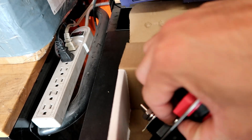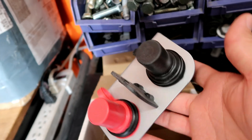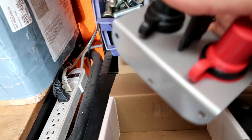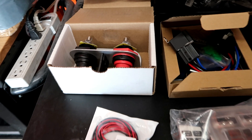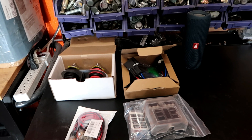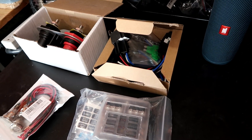Some switches. These are battery terminal posts for remote location, and this is just in case the battery is dead and needs to be jumped. It's easily accessed since my battery sits under the dash, so it's going to be remote located — easy to access to connect another battery or a jump box to it.